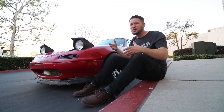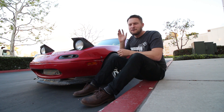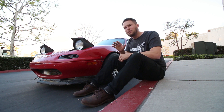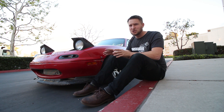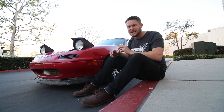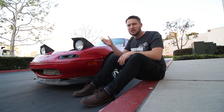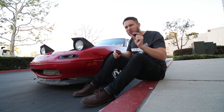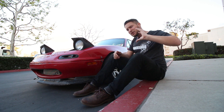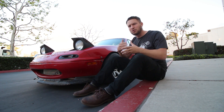Since we're not dealing with Hondas here, we don't get those large horsepower spikes. For that reason I usually do my pulls in third gear as opposed to second gear. If you've got any sort of swap or forced induction in your Miata or whatever car you're using, it's going to be more prone to wheel spin in a lower gear — and it doesn't even have to blow the tires off. Even if you hit a small bump in the road or a reflector, that little blip of wheel spin is enough to throw off the graph.